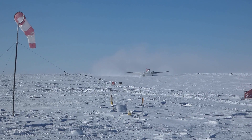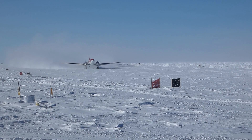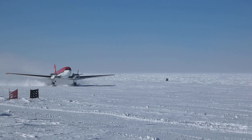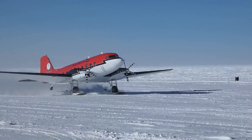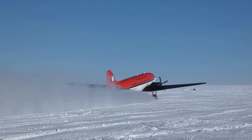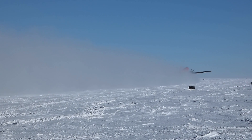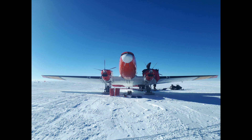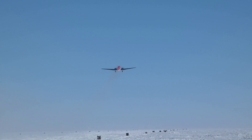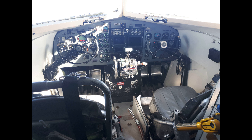During the refueling process I talked to one of the flight engineers. He told me that the airframe of that very aircraft was built in 1943, which means it's more likely a C-47 rather than a DC-3. The official name is Basler BT-67, which utilizes the rugged and reliable airframe of the Douglas DC-3. The airframes undergo complete overhaul, the center and outer wings are considerably reinforced, wing tips are modified, and the Pratt & Whitney piston engines are replaced with much more reliable and quiet Pratt & Whitney turboprops. On top of that, the flight deck is completely refitted with state-of-the-art avionics.